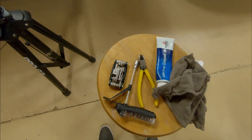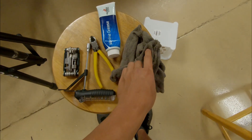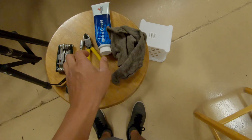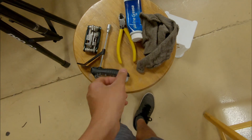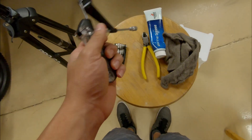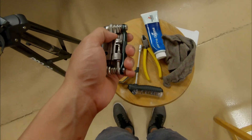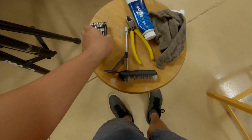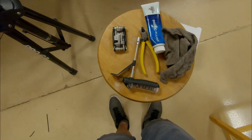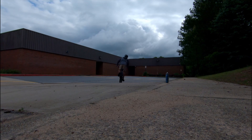The tools you'll need to do this job are marine grease or your choice of bike grease, a rag, cable cutters if you have a zip tie holding in your cable, a torx tool for your stem, and then a 4, 5, and 2.5 millimeter multi-tool or allen key set. You don't need a bike stand for this job but having one will make it much easier.